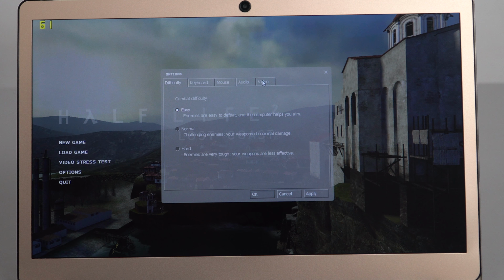Okay, so in order to apply this mod, there is a link in the description of this video if you happen to be watching just on YouTube. And if you read through that article, there's just a few warnings on there. There's also recommendations on what laptops I have tested that have copper heatsinks that I recommend that you could get away with doing this tweak on. But there's some that I don't recommend. And just basically a big warning. So download the application there, which is Read-Write Everything. I've got it running here now. Go into Access, down to Command, and that is where you will paste the command right here, and then you should have this come up.